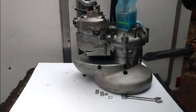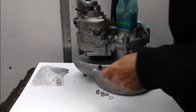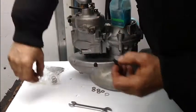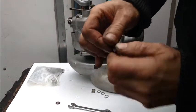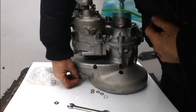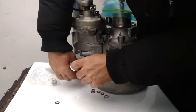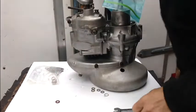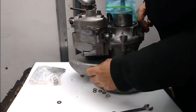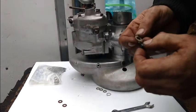Using our 3/16ths British Standard wrench, we'll start at the far side — it's quite simple. Take the old washer off the drain plug or check plug, make sure the plug is clean, put a new washer on it, and screw it back in. This plug here we'll have out again when we add oil to the chain case; we simply fill until it starts to dribble out, and that's how we know the level is correct in that chain case.